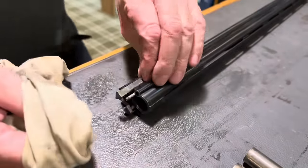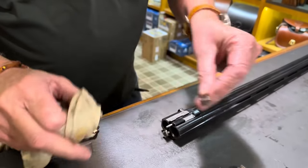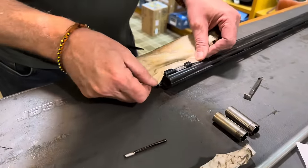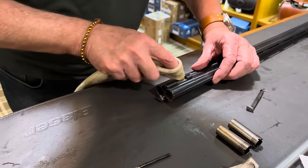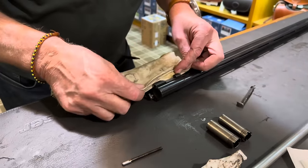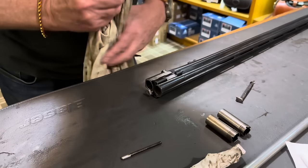Push it in, twist it out — don't let it go. Look at the filth in behind there. There's your plunger and your spring. This is a channel — that channel needs to be clean. As long as you keep a little drop of oil in there it shouldn't hurt. Use a cloth like this, an old t-shirt.